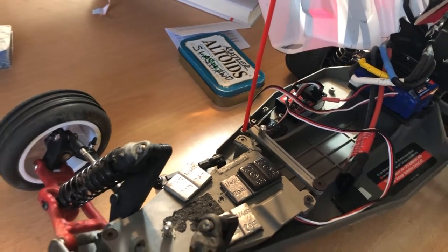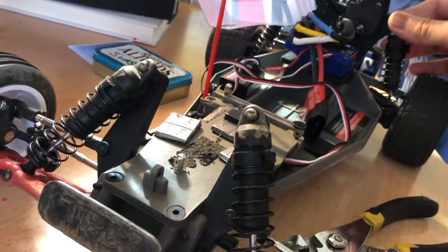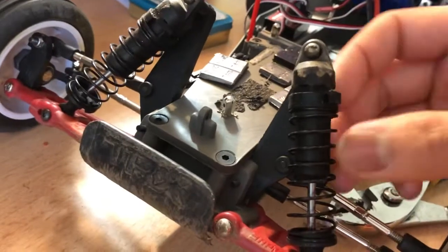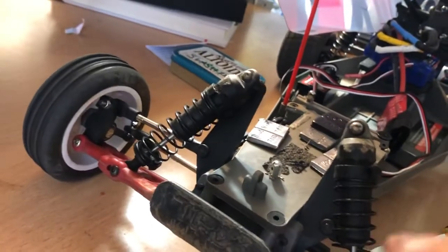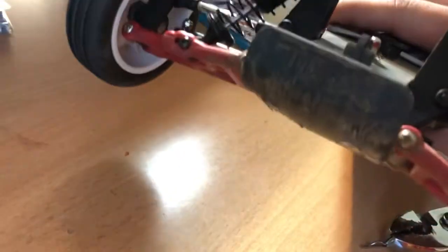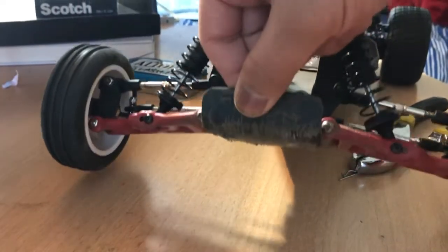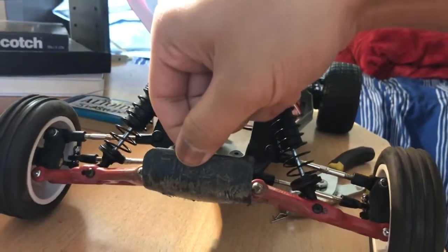without too much understeer. So what I did for setup wise is I put all four shocks at 100 weight shock oil. And I adjusted the droop a little bit by adding some of those little shock spacers that go on the shaft, so it prevents a whole lot of droop, as you guys can see on the front. That's fully compressed, and here it is off. When I lift the buggy up, you don't see a lot of droop going on right there. Not a whole lot.